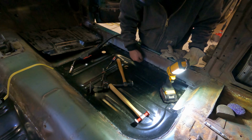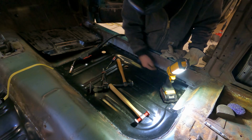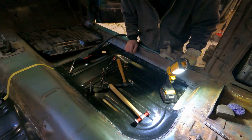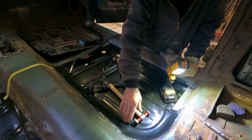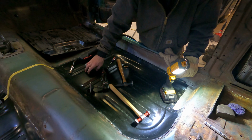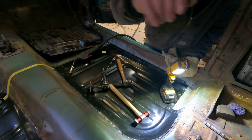And the weld through primer, make sure when you have to do your plug holes on the 3M stuff that I'm using, it was just splattering like crazy, so I just got to go through and clean those up. That way it has a good plug weld. But yeah, I'll just finish welding this thing up and then finish up these tomorrow. So that's it for today. I will see you guys in just a few seconds.